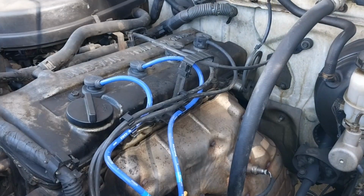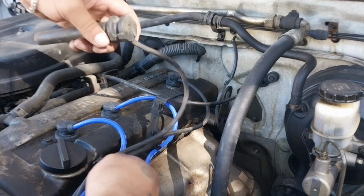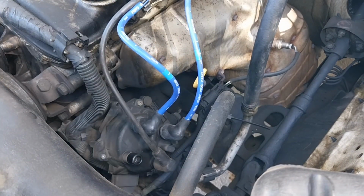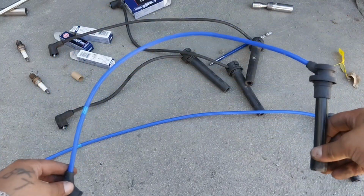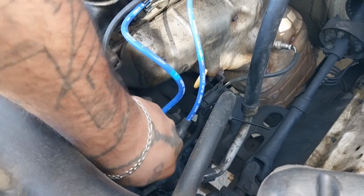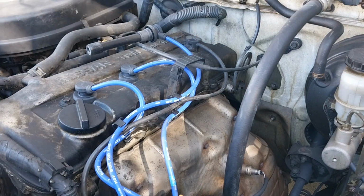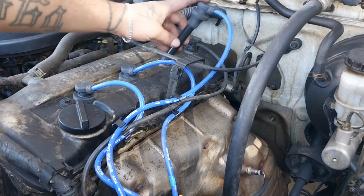And like that. Now grab cylinder 3. Feed it through. Pop it off the clip. Come here at this clip too. And now it's going to be this one right here. And then again, measure the size. It's going to be this one. Let's go. Now just reconnect it. Now just reinstall it on the clips. And that dielectric grease. Like that. And reconnect it.